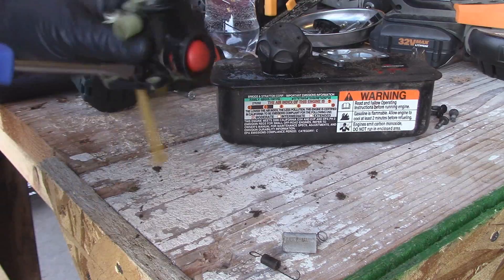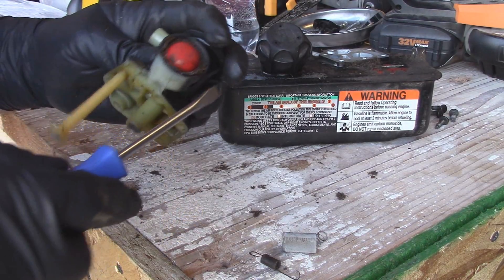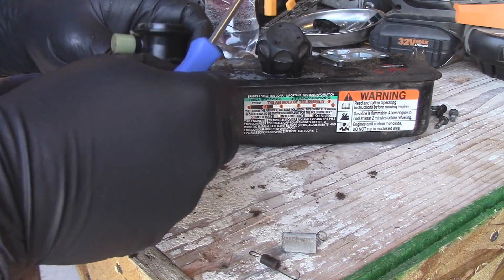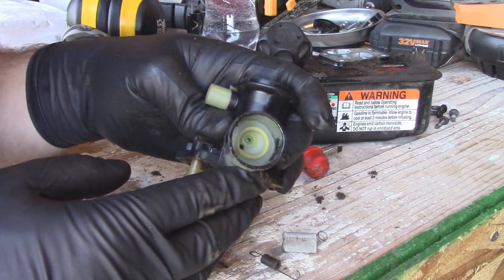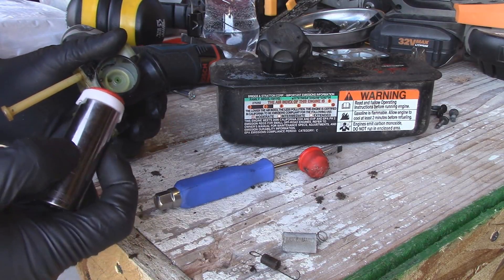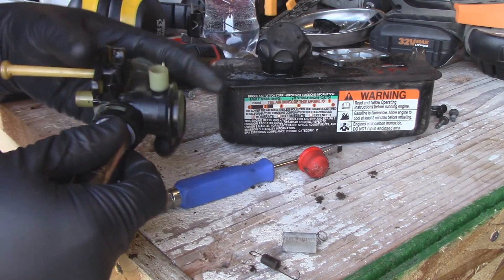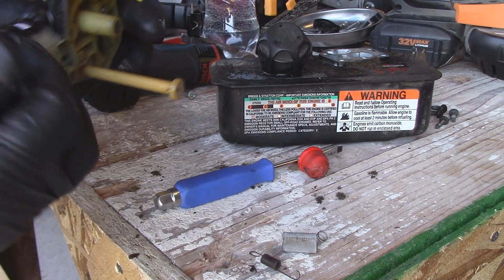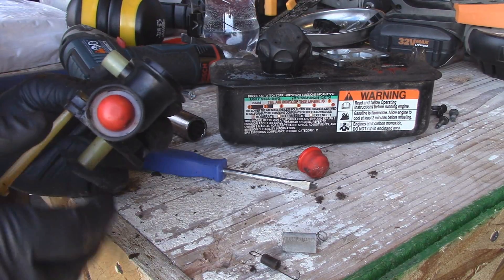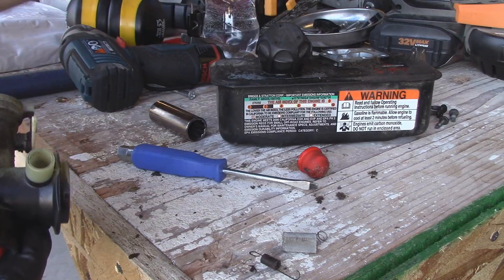Now that we have the carburetor itself, I've already popped out the two tabs for the primer bulb. It's really just one of those things where you take your time pulling them out. Retaining rings out and the primer's out. Looks pretty good inside — I'll spray that out. The trick with getting your new primer bulb in is to use a 17mm deep socket because it fits around them perfectly on the inside. Line it up so both tangs are going to seat properly in the carb, push it forward — you might need a little bit of force — and there you have it. New primer bulb installed.